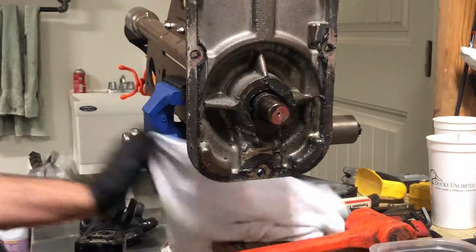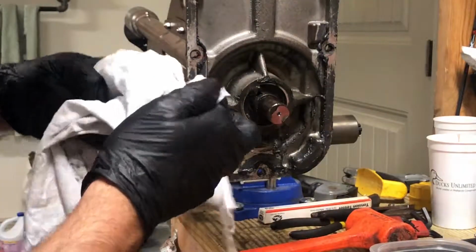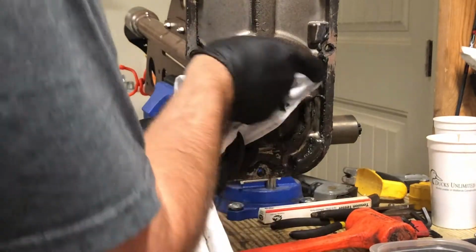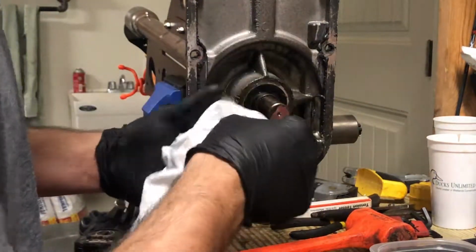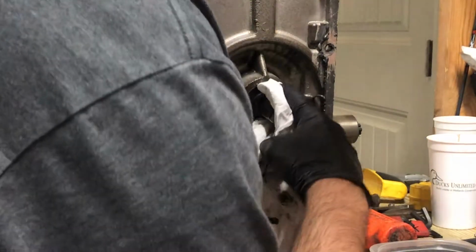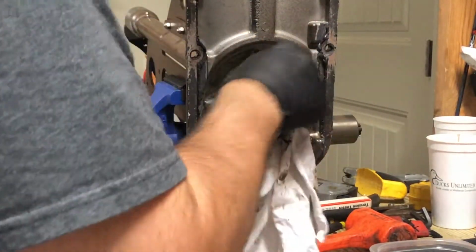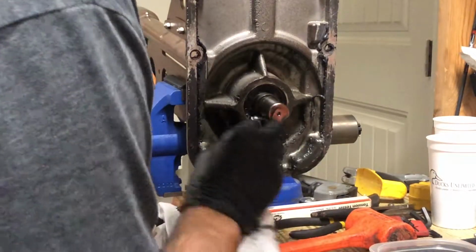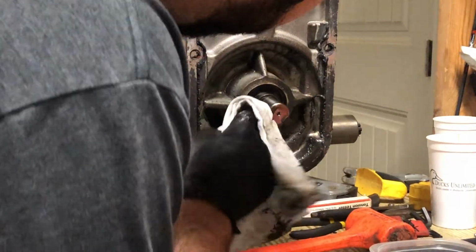All right, time to clean this thing up. I blew out this grease seal, so that's why I'm only replacing the seals and not the bearings. Bearings are actually perfectly fine. So, all right. There can be so much grease in the way.